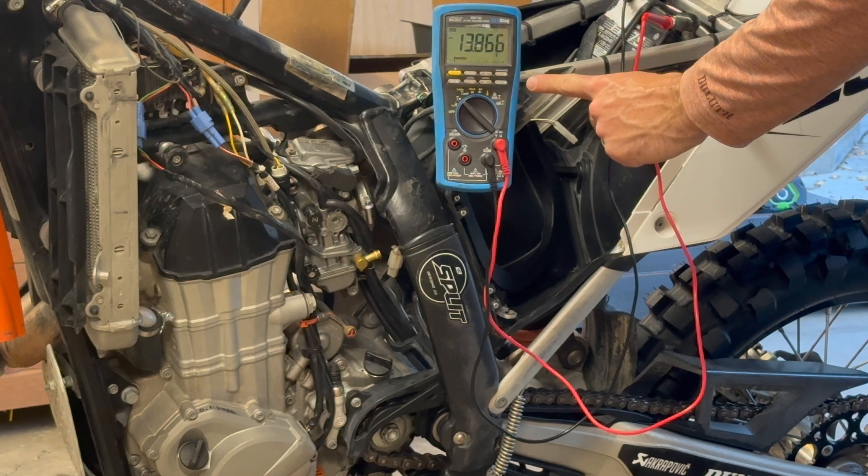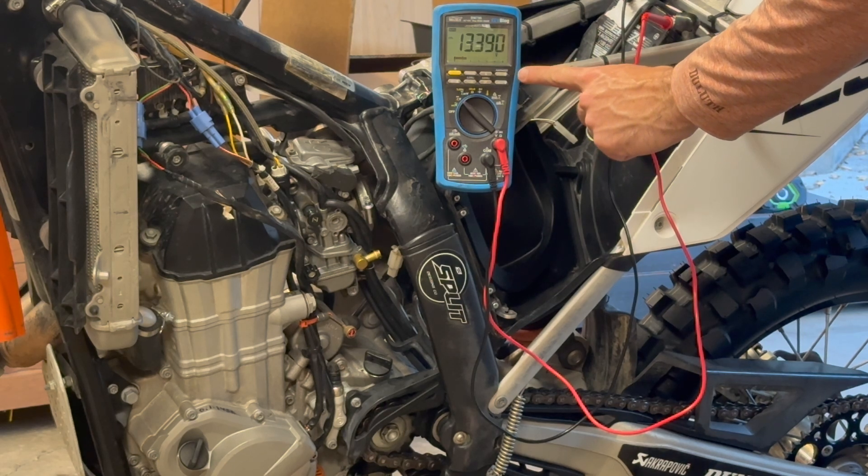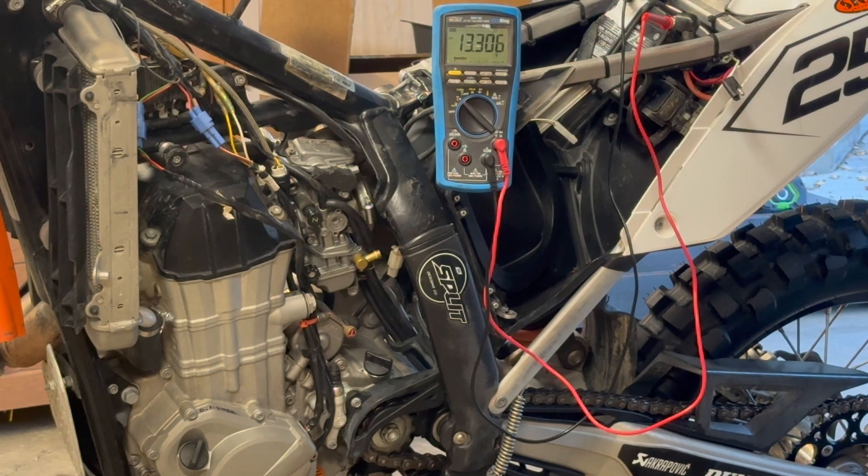We were at about 14.46 - let's call it 14.5 volts - with the engine at idle. As soon as I shut it off the voltage drops down steadily, which makes sense. We expect a resting voltage on a good 12-volt battery around 12.7 volts, though with a used battery you'll typically see 12.5 or 12.6. With a charging voltage we're expecting around 14.4 to 14.7 volts, so seeing 14.5 volts at idle tells me the alternator is doing its job. The light winding did have about twice as much resistance as it should, but for now I'll let it lie and see if any problem develops.